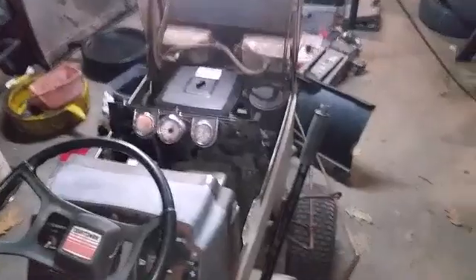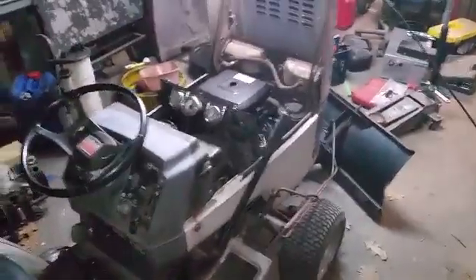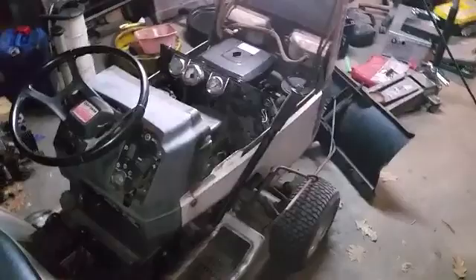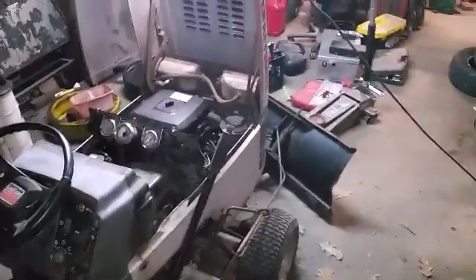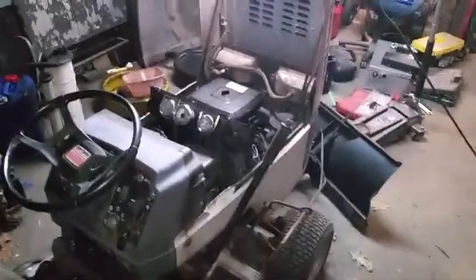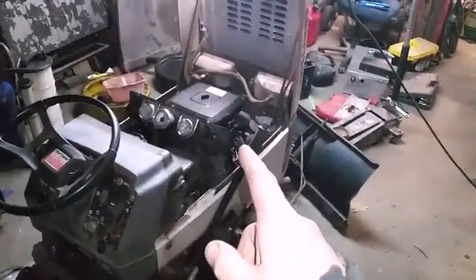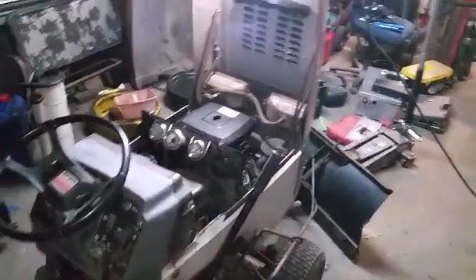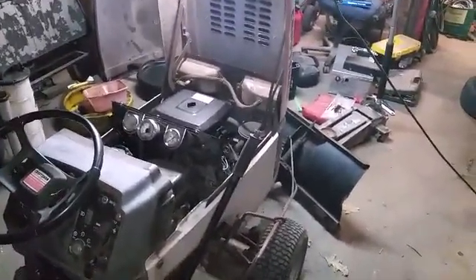That's a little bit better. I'm happy with that. It's definitely better than it was. I can actually keep it running now — before it would just stall whenever it was cold. This carburetor is a clean carburetor, so I wouldn't go messing with the float level until you know that's a possible issue. And even then, if you start messing with float levels you could probably have leaks.